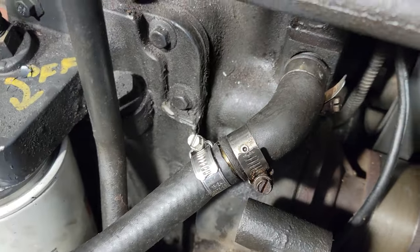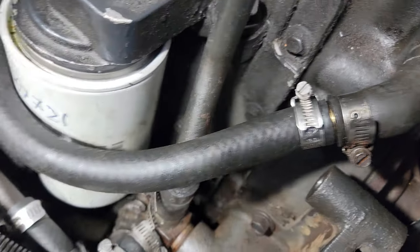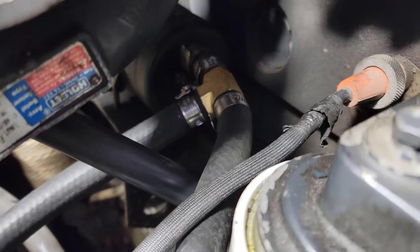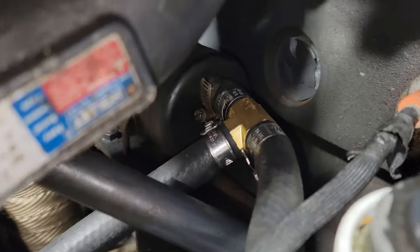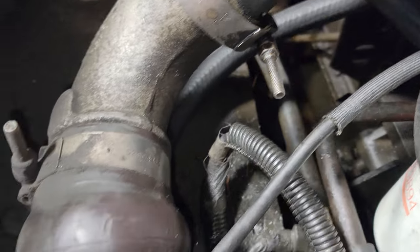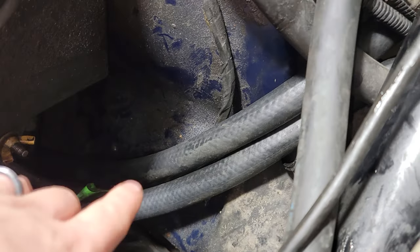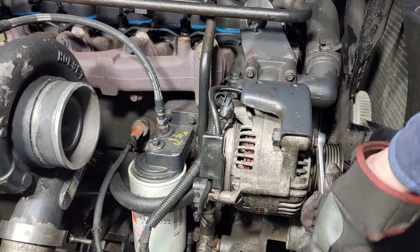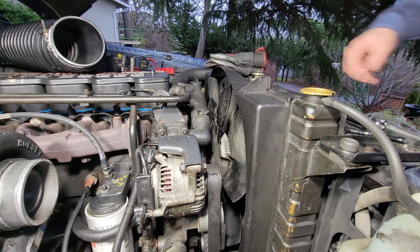To show you in detail: the supply comes from the factory 90, I join the two hoses and go around the oil filter, and my tee is just before the fluid-to-fluid heat exchanger. The supply line runs back there and then the outlet runs into my tee.